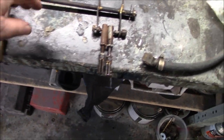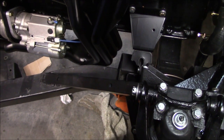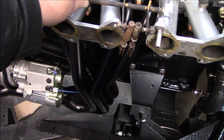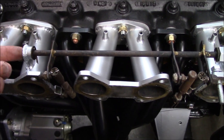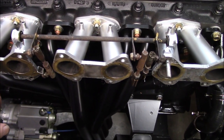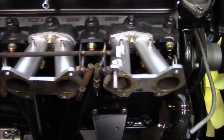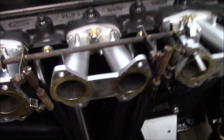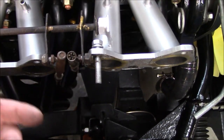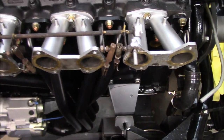The next piece of the puzzle is this linkage bar — again, very custom made. It has little brass bushings that ride up in two nuts welded onto it, and those go into position on the intakes. I actually need to remove one of the intakes to be able to install the rod, and then it's capped with cotter pins on either end to keep it from moving between the two fixed points. The individual carb linkages hang down from there — they're a little bent, which is how they came off the car, apparently for clearance of the intake. Instead of repositioning the bar, the previous owner just bent them over.